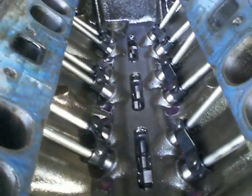Now the camshaft you can see down in there, see it rotating, it's got a bunch of bumps on it. As the bumps hit the lifters, it pushes them up and down. You've got 16 of them. Now all them lifters there, as they're going up and down, they push these push rods.